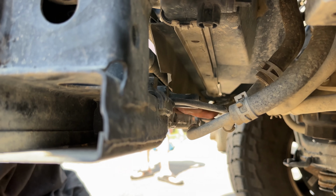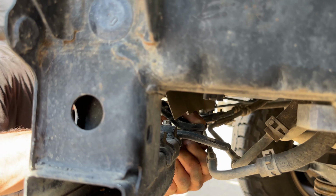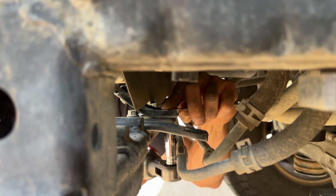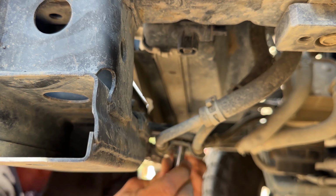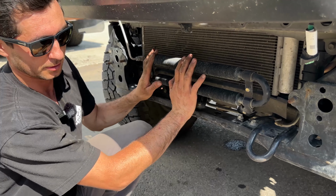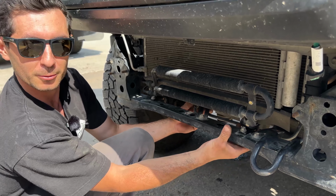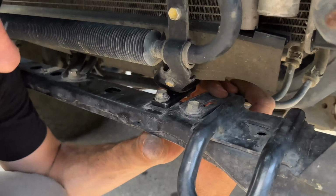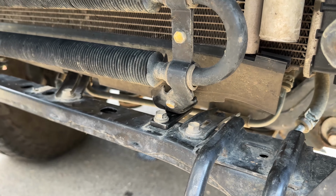Okay guys, so we're going to take that off of the motor. Alright guys, now that you have your relocation tabs on the oil cooler, the next step is there are 2 oil lines underneath it, potentially could interfere with the bolt. So what you're going to want to do is there's this tab right here, and you could either use a crescent wrench or your hands, but we're going to just want to tweak this down a little. Actually, we need a crescent wrench.